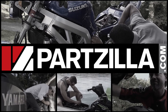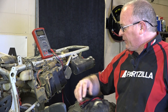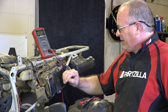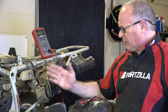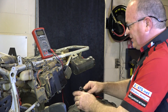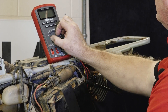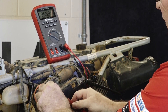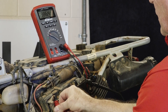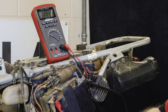One of the first things we need to do is go ahead and take just a static reading of the battery voltage at rest with the vehicle shut off. We just want to see where it's sitting right now. So we want to set our meter to just volts DC — just two lines straight across. And she's reading about 12.21, 12.2.